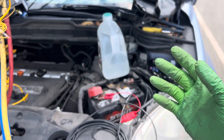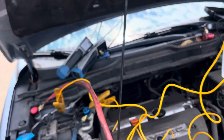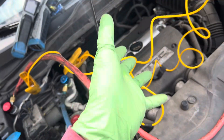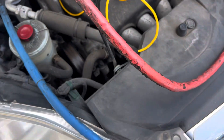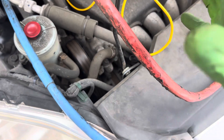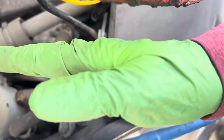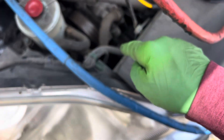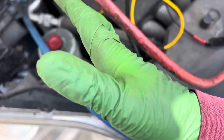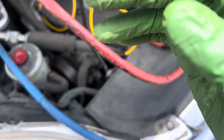This vehicle is a 2007. If they never did a recharge before, 98.9% of the time it'll need a recharge — that'll be something to do. But there's also a concerning noise: I hear a mechanical whirring noise like a bearing, and I can see a bit of a wobble on the pulley down there. I wonder if the pulley bearing went bad. When the pulley bearing goes bad and the plate moves around, sometimes it'll hit the coil and wear through the windings, shorting it out.